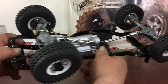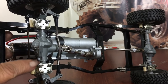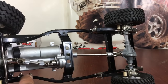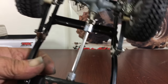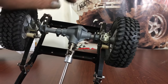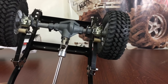And so basically, you can see how these axles fit in the front. They're a little bit towards the center of the pumpkin, and your drive shaft is at a bit of an angle. In the rear, you can see that it is at another angle, slightly off-centered for the back, because the 6x6 had another rear end behind this one, and the other drive shaft came down this way. So there's a real long shaft that goes by this one. That's why they off-centered it.